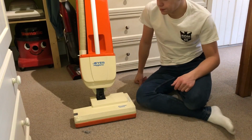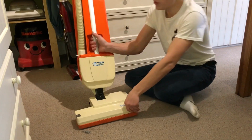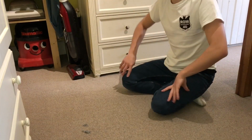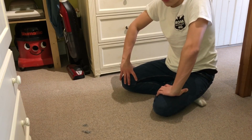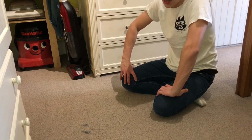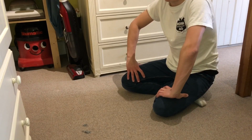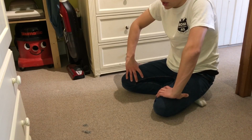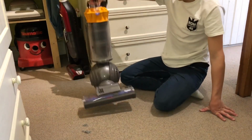So I thought I'll use something different, because I had it sitting in the shed, and the original owner for this particular vacuum didn't want it back because the motor had blown, and I had one in the shed that was a pre-EU model. So I thought, why not refurb it, put the pre-EU 1300 watt motor in it, and see how it performs daily in my house. Well, I only vacuum once or twice a week. There's no need to vacuum every day. But what I've got is this. This is what I have got.